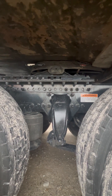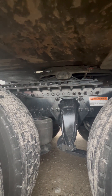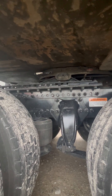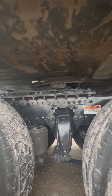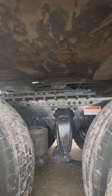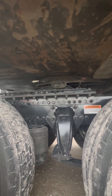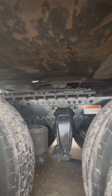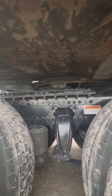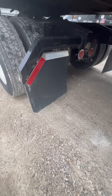I got my mounting bolts and platform — properly mounted, secured, not cracked, bent, or broken, or missing. I have my locking pins, my safety release latch, and my airline — properly mounted, secured, not cracked, bent, or broken, the airline is not cut, torn, frayed, or leaking. I got my skid plate and the apron — properly mounted, secured, not cracked, bent, or broken, properly greased, and there's no daylight between the apron and the skid plate. I got my locking jaws and the kingpin — properly mounted, secured, not cracked, bent, or broken, or missing, and the locking jaws are locked tightly around the shank of the kingpin.